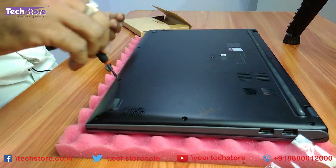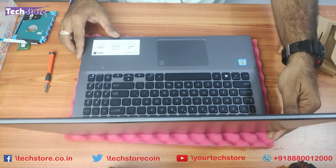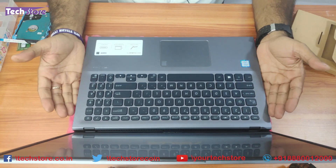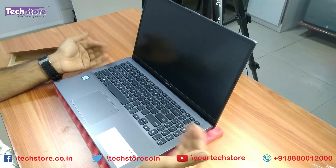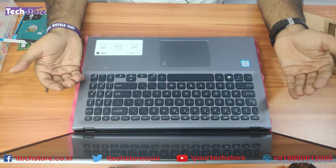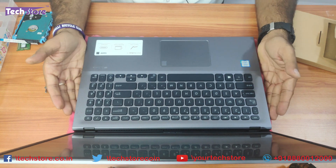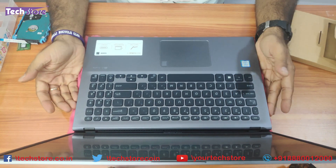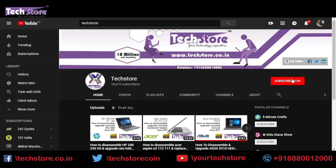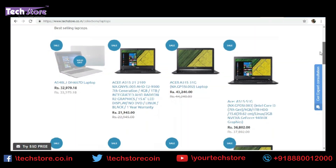Let's reassemble it back. Just press it slowly and put the small screws in first. In this video we have shown you how to remove the base and upgrade the Asus X512. You can put an M.2 NVMe SSD, add RAM up to 20GB total — 4GB is soldered onto the motherboard, so another 16GB DDR4 can be added — and you can put an additional hard drive using the hard drive kit included. It's very seamless, the design is very nice, and it's a very good laptop from Asus. Thank you so much for watching. Do let us know your suggestions and comments, and don't forget to subscribe. All parts and components are available on our website at www.techstore.co.in.